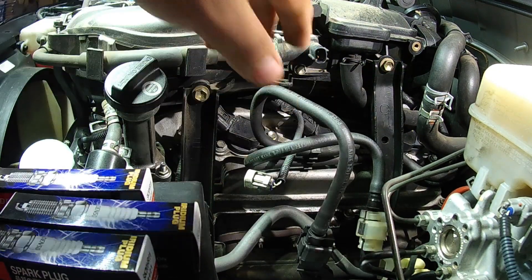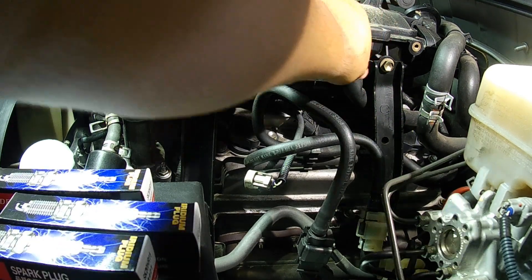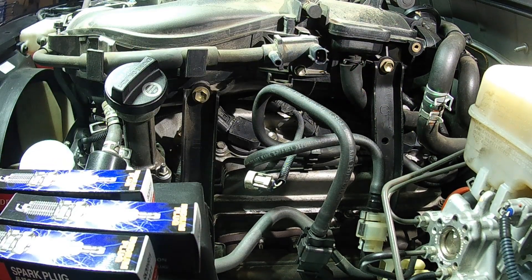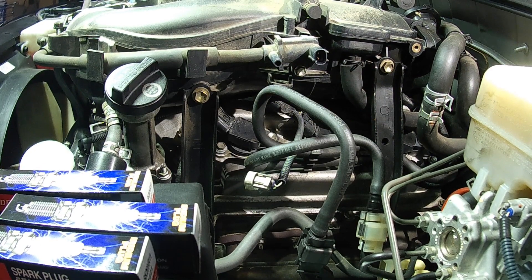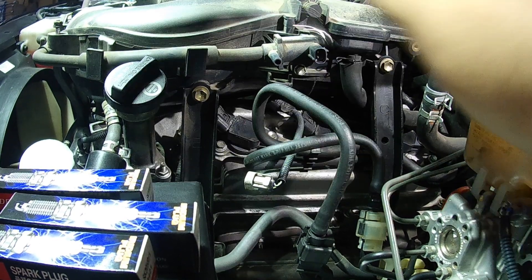As you can see, we're getting room to move the coil packs. Down at the end of this bracket on the right-hand side of your screen, there's a 12-millimeter bolt down there and one up here. You'll probably just loosen the top one and take the bottom one completely off to gain access to the coil pack. We might also need to move this hose right here — these two little clamps just squeeze together with your thumbs. It looks worse than it actually is.